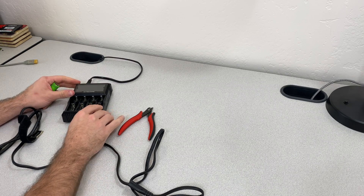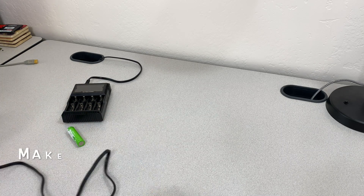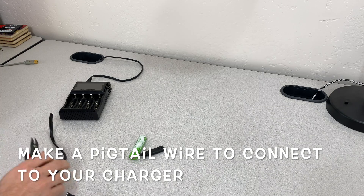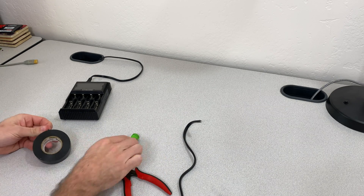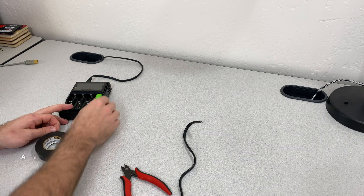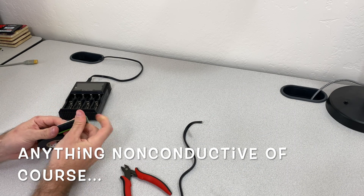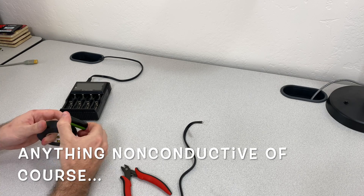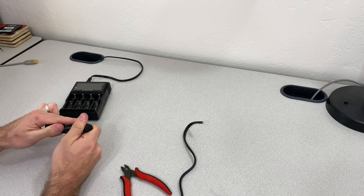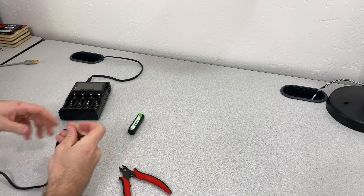I'm going to go a little more extreme here and use this inter-core charger. Essentially we're going to set this up so I can get some leads on the battery. You can use a wooden dowel or basically anything that will fit in here — I'm going to tape it off. I just needed something the right size to hold these leads where they need to be. This is actually a cell pulled out of a different dead Lenovo battery. We're going to use it as a spacer.